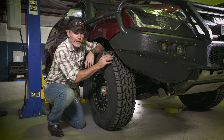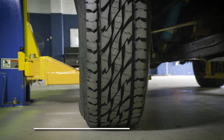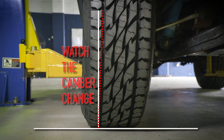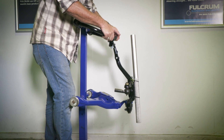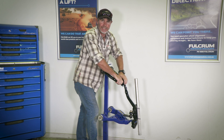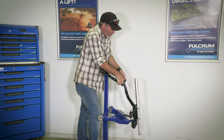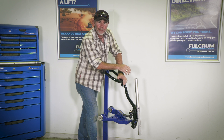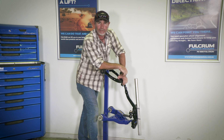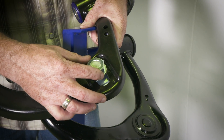The complications of lifting your four-wheel drive and how to fix it. I'm just going to simulate a suspension lift on a four-wheel drive here and show you just how much that camber can be thrown out. What is camber? Camber is the top of the wheel in or out. You can really see how much that camber does get thrown out across the range of all IFS vehicles. Now that camber has to be corrected. Fortunately there's an easy fix: Adjustable Front Control Arms. I want to further illustrate that point using the front end of a 2010 model Hilux right here, using this jack handle to simulate the tyre. Keep your eye on the top of the tyre so you can see how that camber is affected when it moves up and down. That really does illustrate just how much a suspension lift will have an impact on the camber of your tyres and why it needs to be fixed. And this right here is the solution — the SuperPro adjustable upper control arm. You can easily adjust the camber and caster back to where it should be by adjusting this ball joint.